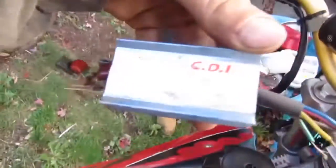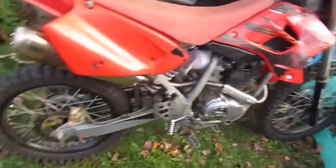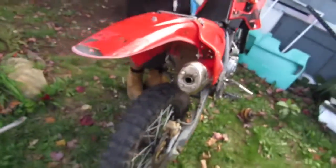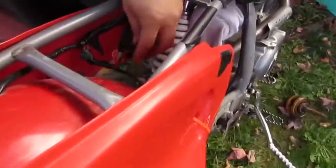It has mad compression — oh yeah it does. Don't break it. I like your air filter — that's fancy. Yeah, it's a uni with a sock over it. How's the frame rails on this thing? I'll give them a 5 out of 10 — it's brand new Chinese dirt bike. Red and black wire from the stator — I threw it to the CDI. It started throwing spark again through the harness. I threw one plug from the stator straight to the CDI and it started throwing spark again, so yeah. I made it work like a normal GY6 CDI. The voltage regulator and everything works — I just gotta put a battery.